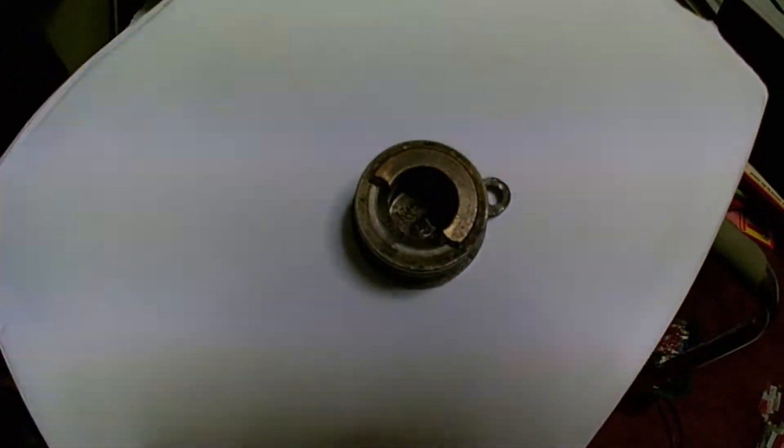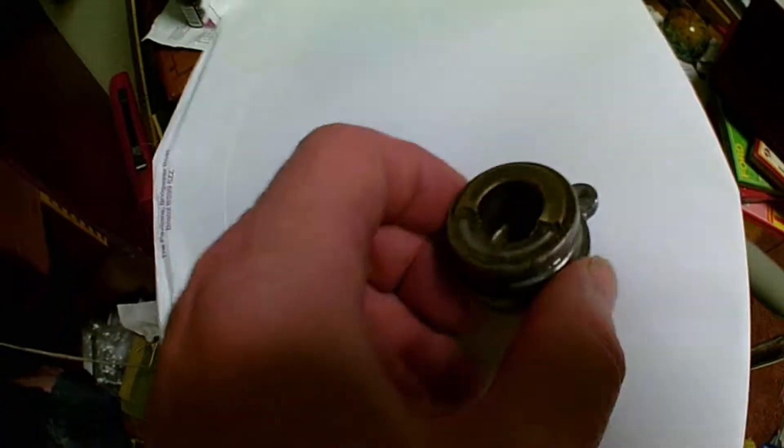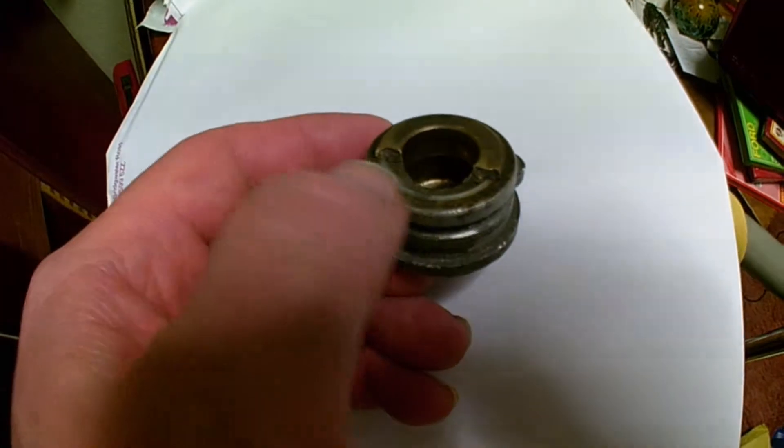It's a bit weak. What's interesting is this is actually on some sort of cam — it's not screwed in the centre where I'd expect it to be. Stripping down the right-hand cover of the Yamaha power valve system, there's a phosphor bronze bush inside this cover and well — half of it's disappeared. I wonder whether it was running in that condition.